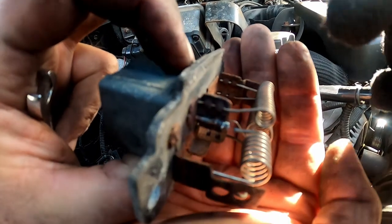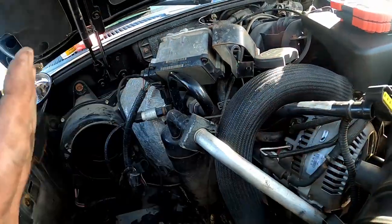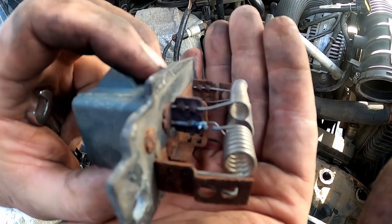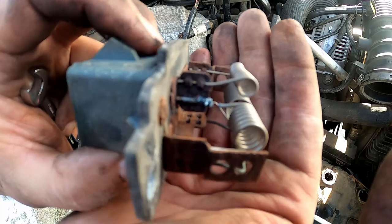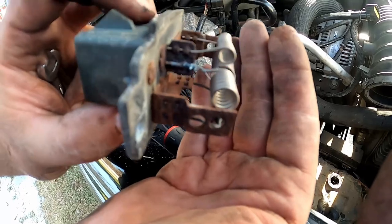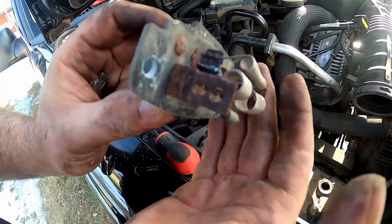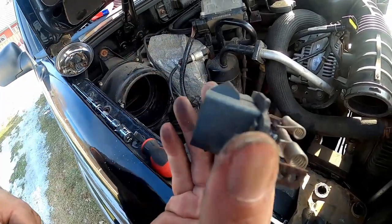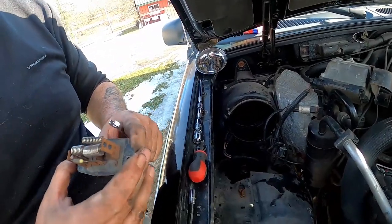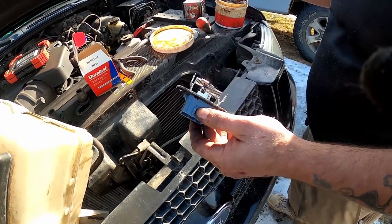I'm gonna hold the left hand in. Don't touch it. Here, come over here in the shade. Maybe they can see it. Right there. Yep, see where it's burnt right in half? And the problem was that she only had number 4 on her blower motor on the inside. And this is what I suspected that went. Can we take that back and get a new one? I don't know if it's lifetime. Got the new one. They look identical, except for this one's not burnt in half.